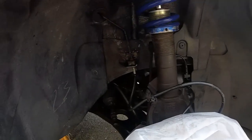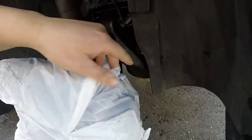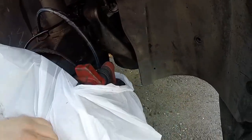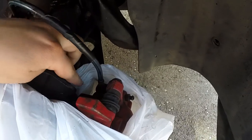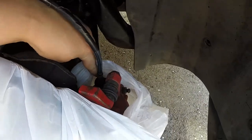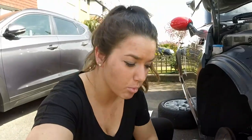I need to disconnect the line, screw it, lift it up and drop it out. I've also got to do the line here, which as you can see has been leaking. I've got to undo that line, undo that line, drop it out, and then bleed the brakes afterwards. The caliper lines are going to be no good - I think I'm going to have to cut them because the top screw bolt is totally knackered. So I'll probably have to cut it and just fit whole new brake lines all the way through. Not a problem - I'd rather do it anyway.